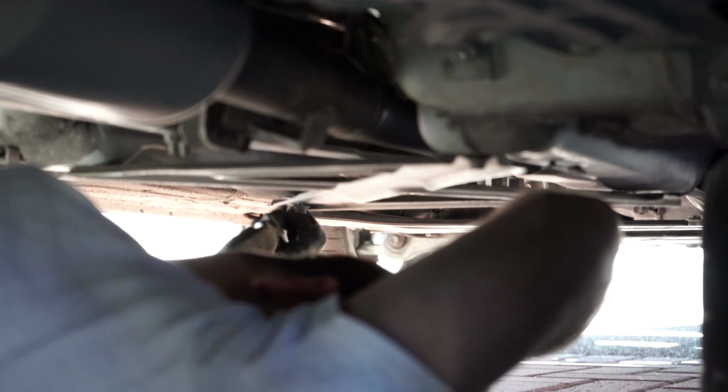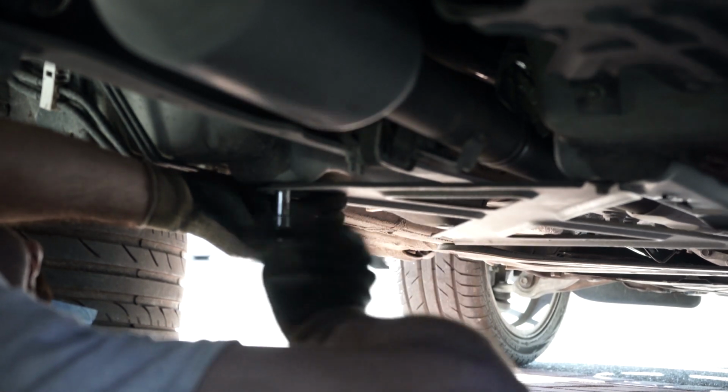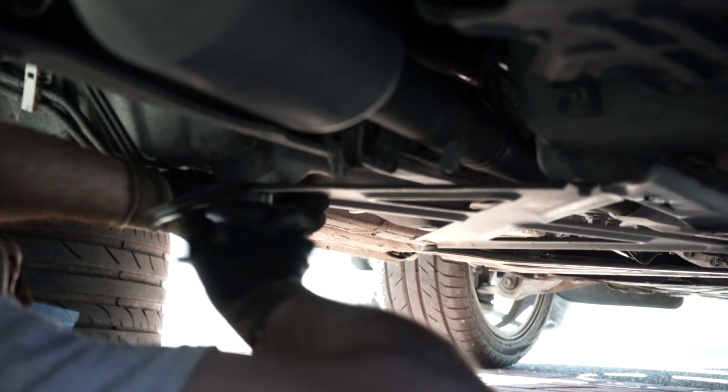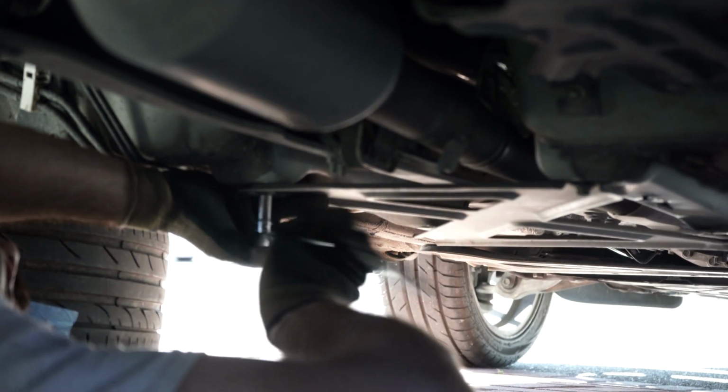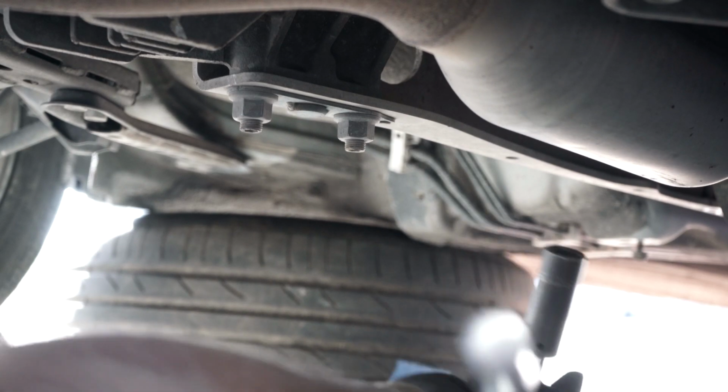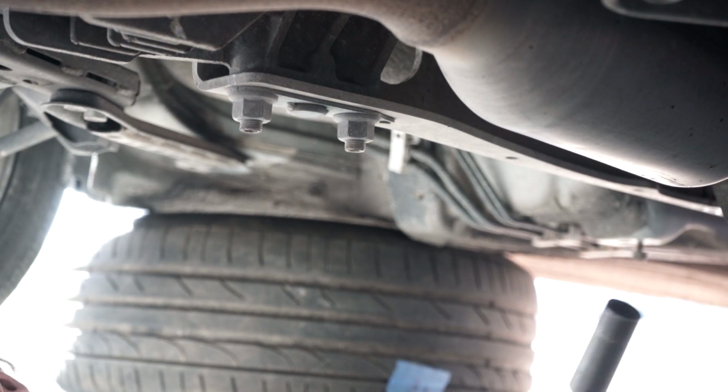Unlike the G35, which has axle stubs that slide into the differential, the Miata's axles are one piece, like the CV axles on a front-wheel drive car. Because of this, the only way to completely remove the diff is to disassemble most of the rear suspension. So to save some time, we are going to lower the diff, remove the cover, and weld it in the car.